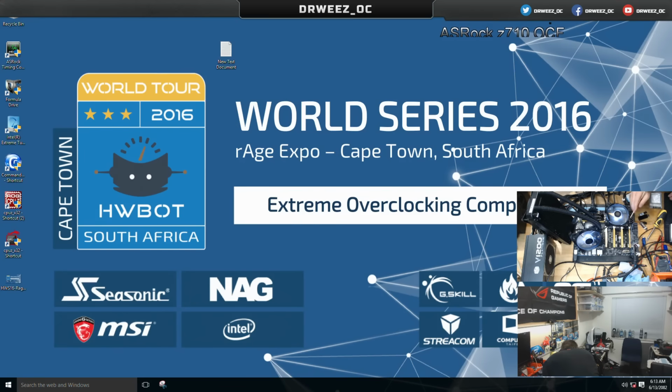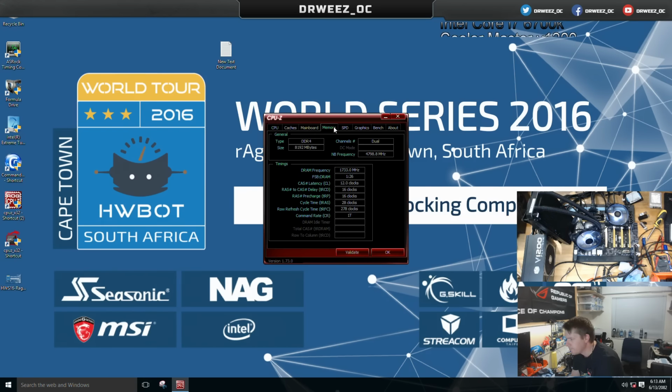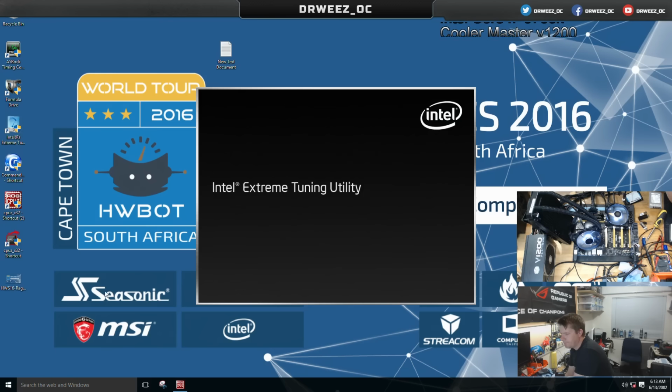Let's try that again. LN2 mode, switch menu 1. So I think LN2 mode is the black one. Anything there. Okay, so that's slow mode. It is the middle one. Okay, so you can see when I hit the slow mode, it just takes the CPU down to 800 megahertz, and then your Northbridge is down to 800 megahertz as well. So we'll go ahead and just put slow mode off. Okay, 4.8, and let's run XTU.